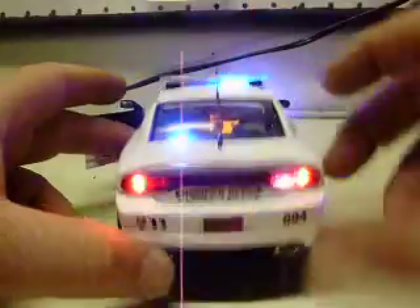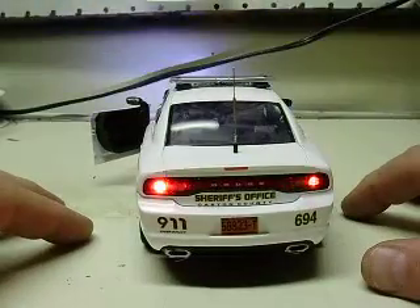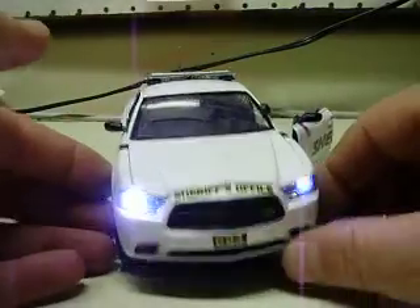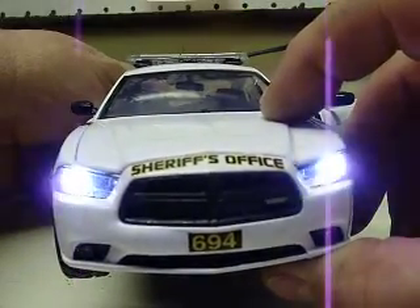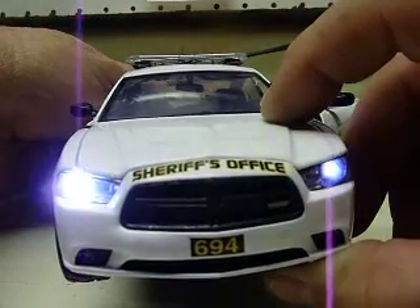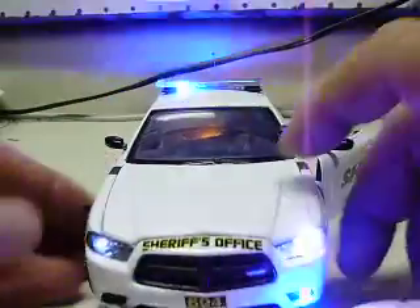Let's go ahead and hit this here. You have your steady lights with that first press — headlights and taillights. First time you press it's a slow wigwag. What I'm going to do is turn the main power off so you can get an idea of your flash patterns. Hit that again, and all that each press does is just speed the flash rate up a little bit more. And then this last one's just like a chaotic, almost a strobe. Next press turns it completely off. So of course everything will operate together at second speed wigwag — the more realistic one, I think.